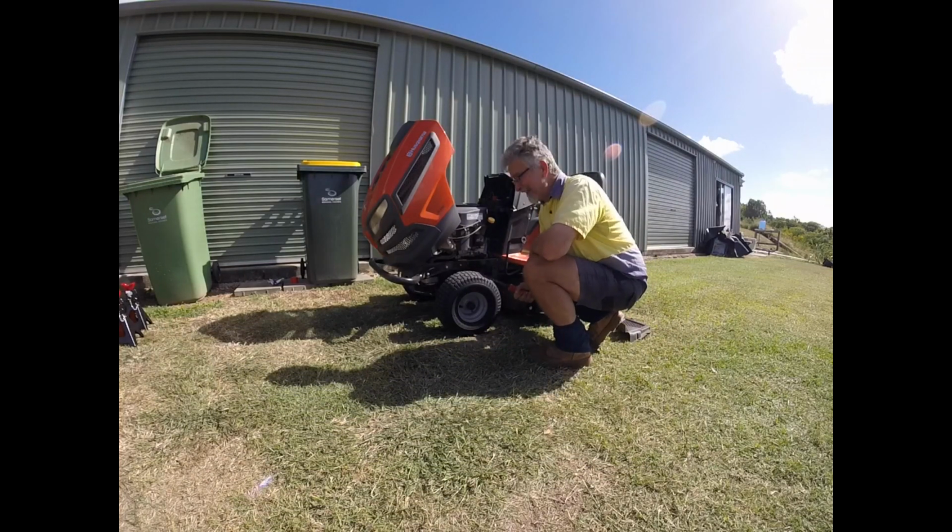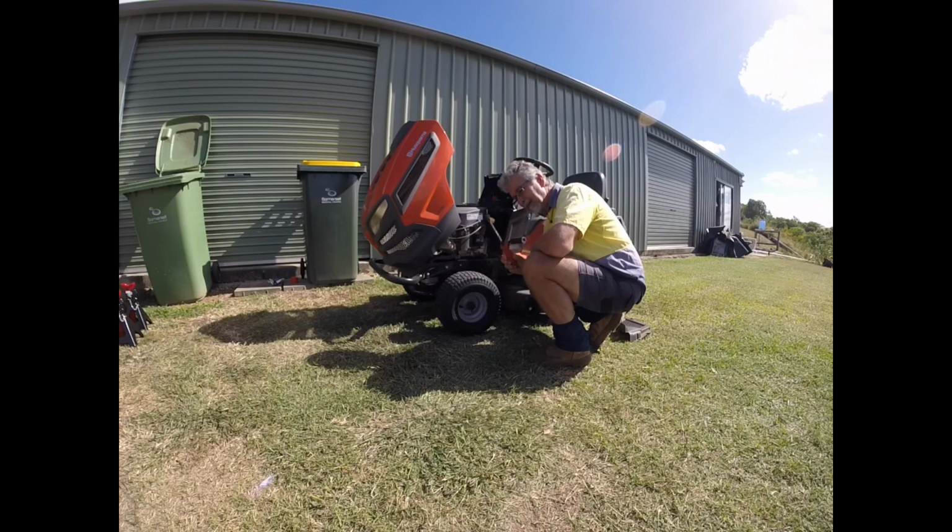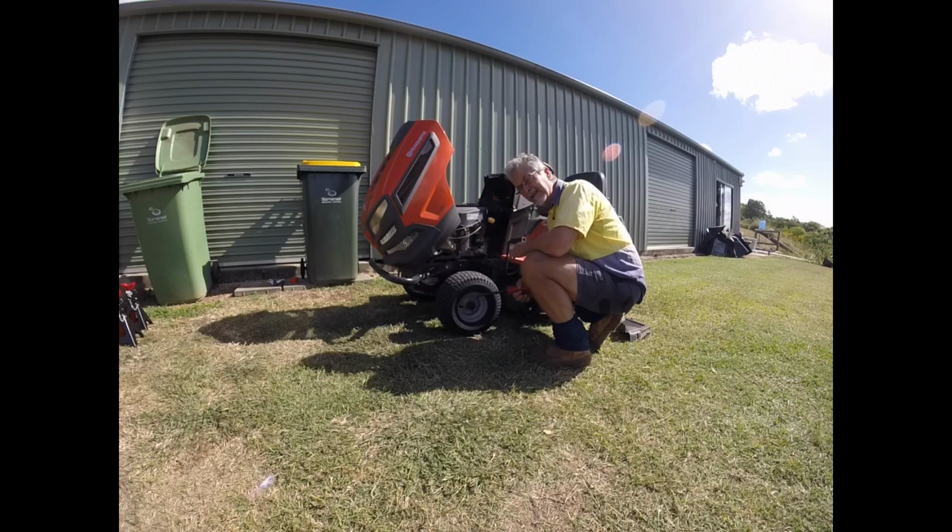Well, okay. I discovered the guys at the mower shop are absolutely right. I had a look down in through there, and now after every time I mow, I give the machine a clean and a blow over with the air, etc., just to try and get all the grass and dirt off. But there was a massive build-up down there of not just grass but also mud, which is not because I'm going through mud, but just the dust combined with wet grass has sort of formed up behind there. I got my pry bar back out of the oil, gave it a clean up, and was able to remove a considerable amount of build-up that was underneath there. So that's a lesson learnt. After each mow, I need to double check that I'm not just blowing air in and around here, but that it's actually getting that debris out from underneath, inside the back of the engine and under the subframe section here, which was preventing the pedal from working properly.